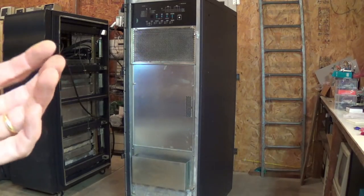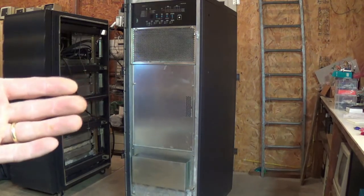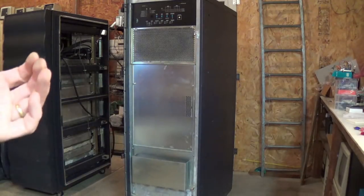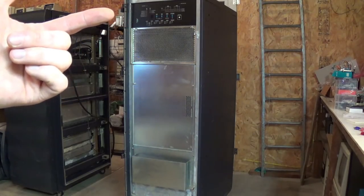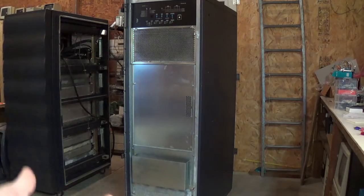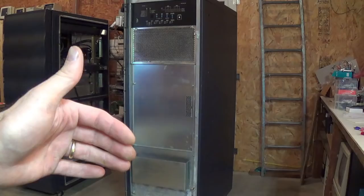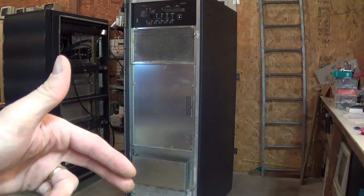The front of the cabinet is missing its door. Normally it has a beautiful wavy door, and the processing cabinet has a similar door but with a silver pendant running down the center with a couple of lights on it. Mine didn't come with the door. The system's face has the CCU, the central control unit, and the outlet for the fans that blow up through the system. This is the back of the backplane; the processors and memory boards are on the far side. Down the bottom we have a pocket for manuals and then the bottom of the power supplies.